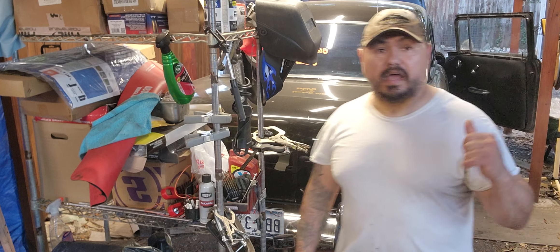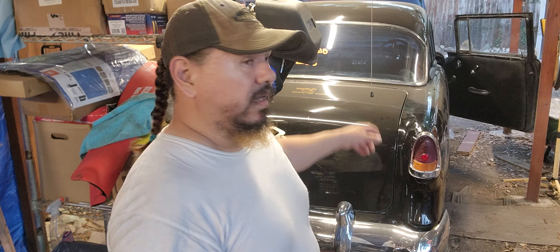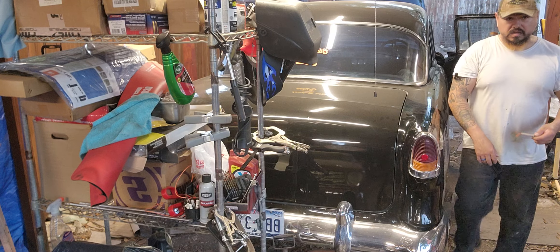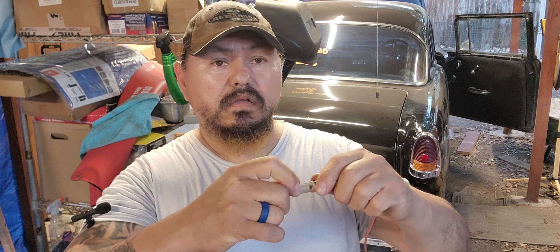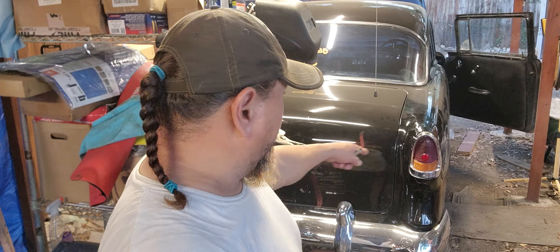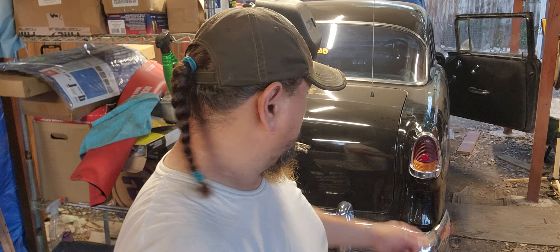Since I have the lights running direct to the battery, I'm gonna have to add a fuse. Luckily the previous guy had a fuse holder in the car — he had one right here, so I'll probably just connect to that one. The wire from the lights in the back is running direct to the battery with no fuse, and if I don't run a fuse my lights could go out. I need to run a fuse on this one too.